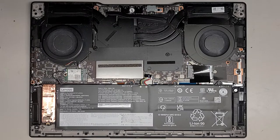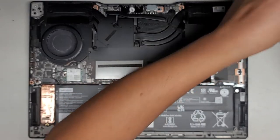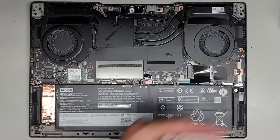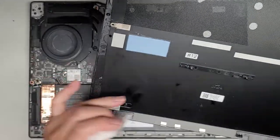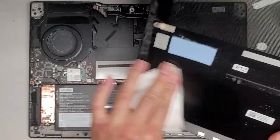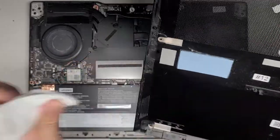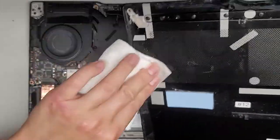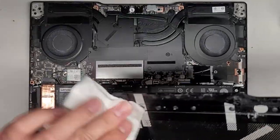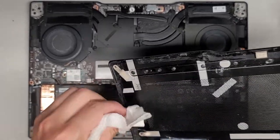I'll actually show how to remove it once I completely take everything apart and clean it up, because this is a somewhat time-sensitive job. I don't want to leave the stuff in there. You can see there's some salty water residue stuck there that doesn't really clean off too well. You can also see it turned all crusty — that's from the salt causing oxidation, basically making the stuff rust extra quick.